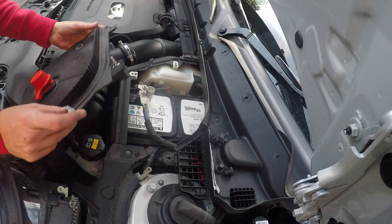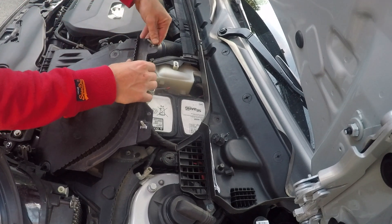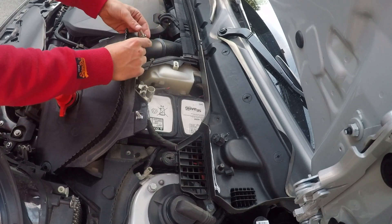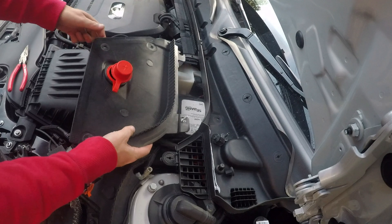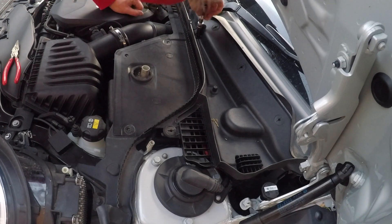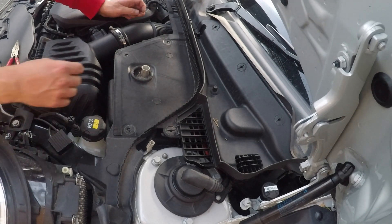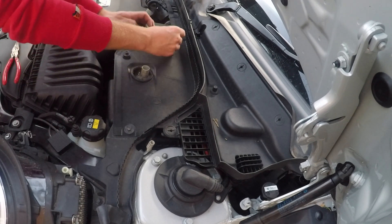So we're ready to get this cowling back on. I did notice that was a bit loose on mine, which is a bit odd — maybe the previous owners have had this off in the past. Might just have to be cautious with that. So you want to stick this back in place — I'm going to lift this up. Make sure your bolt comes through the top there. So we've done those 10mm bolts up at the back — they're done and in. Put these 8mm screws back in: 1, 2, 3.